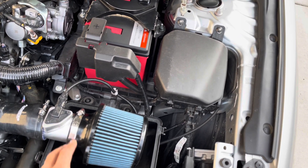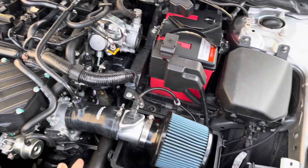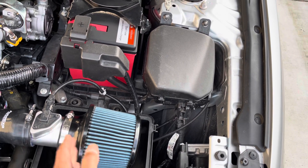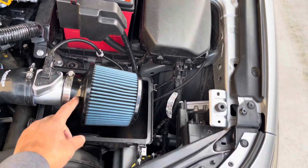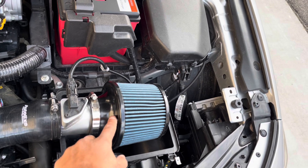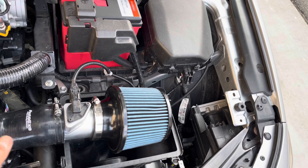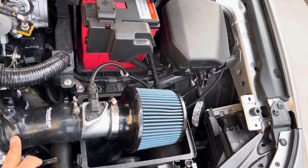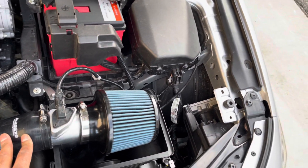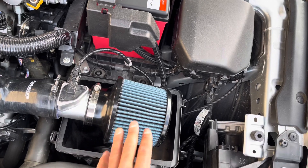It's probably a little bit more efficient to have it open like this because at 80 mph, I'm not forcing extra air in here to use up more MPG. One great thing about this Injen filter versus other filters is that it has a built-in bell mouth — the bottom is shaped to smooth out the air. On the inside of the filter there's a lip that comes flush with the MAF housing, so there's no turbulence between the MAF and the filter — it's a flat, straight path. The only resistance I hit is where the throttle body connects to the hose. We tested the flow of different filters and this one was very efficient.